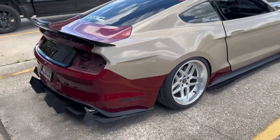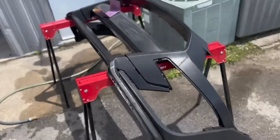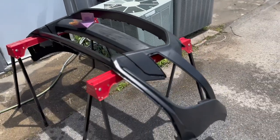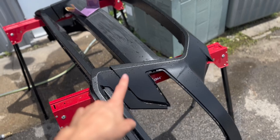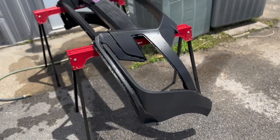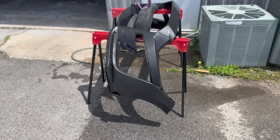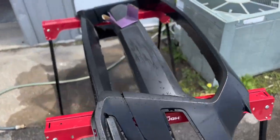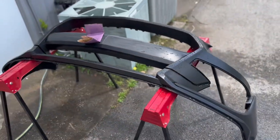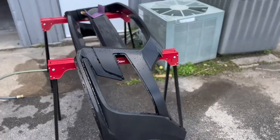Let's take a look at getting the bumper prepped. In order to wrap a brand new plastic or poly bumper, you actually have to sand it down and primer it first, because as you can tell by how all the water is beading up on it, this plastic almost acts like a ceramic coating - the material does not stick to it whatsoever. You either have to use crazy adhesive promoter, but we're not that type of shop, so what I'm doing right now is sanding it down with 220 grit, getting the plastic all roughed up. Then I'm going to hit it with a primer and do a couple stages of sanding all the way up to 2000 grit, and from there she should be ready to wrap.